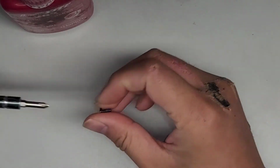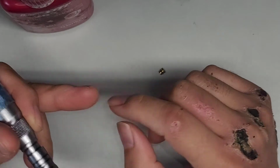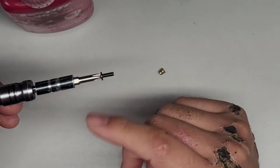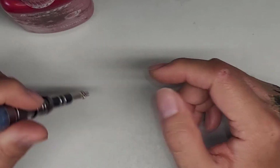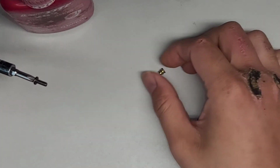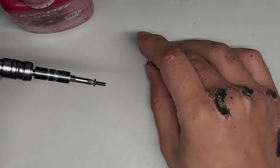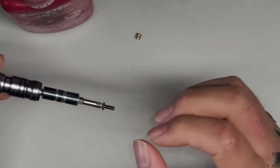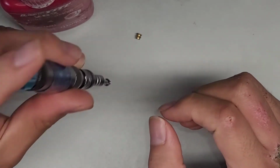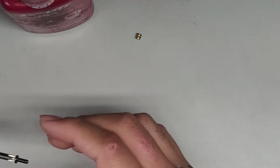They were saying that instead you can use fingernail polish varnish or something to lock the top of the thread, or the top of the screw, I guess, into place. So that was what they were telling me to use instead. I mean, that's a good idea as well, because that kind of thing doesn't constantly grip. It's more like when you have to take it out, it'll just crack the varnish and it will come off.